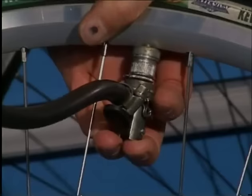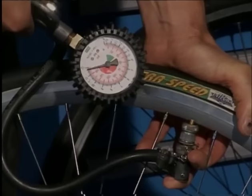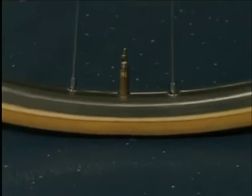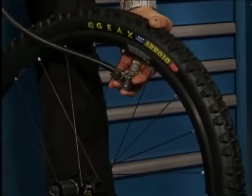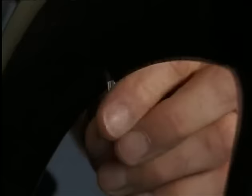The correct tire pressure is a key to safety, comfort, and smooth riding, which is why tire pressure should be checked before every ride. Most tires have the minimum and maximum pressure on the flank. Of course, tire pressure also depends on the rider's weight, the type of terrain, and the tire width. A rule of thumb for road competitions is 100 to 130 psi, for cross country 30 to 50 psi, and 140 to 180 psi for the track.